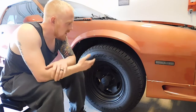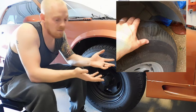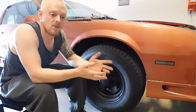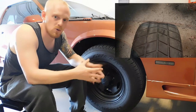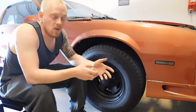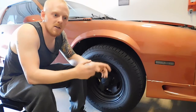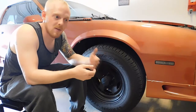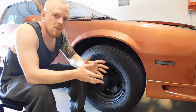If you're good there, then you want to take the wheel off and really inspect it to make sure your tire doesn't have cancer — and what I mean by that is tumors or bulges in the tire. If you have lumps or bulges, that can not only cause a rough ride but you would hear like a droning in the car — wah wah wah. The faster you go, the louder and faster it gets.